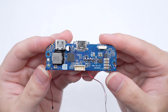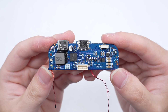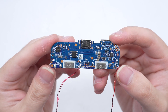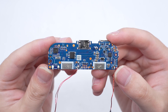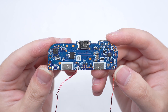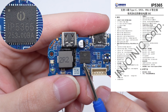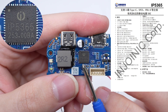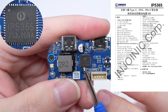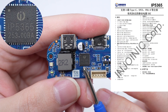The front of the PCBA module has a wireless charging master control chip, a battery protection chip, a USB-C connector, an MCU, and two thermistors. The back of the PCBA module has an alloy inductor, SOC, USB-C cable socket, V-bus MOSFET, two wireless charging MOSFETs, and a series of resonant capacitors. The SOC is from Injoinic, supports multiple fast charging protocols, integrates lightning input communication, has multiple protection functions, and supports external NTC for battery temperature protection.